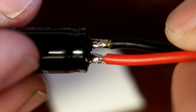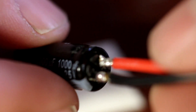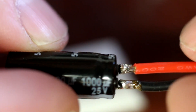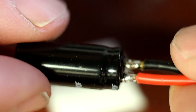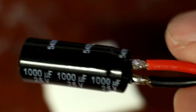This is the best way I've found to attach the wires — go on the inside of the pin so there's no chance of your soldered wire touching the case. You obviously don't want that on the positive wire. Add a capacitor — it can't hurt, it can only help. It may make your motors actually sound smoother, even if you don't have any twitch issues.